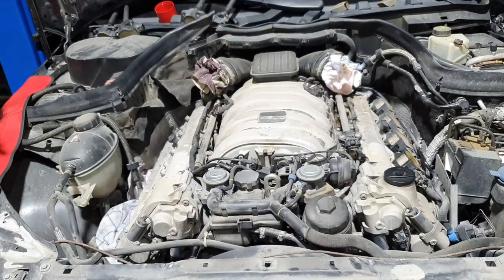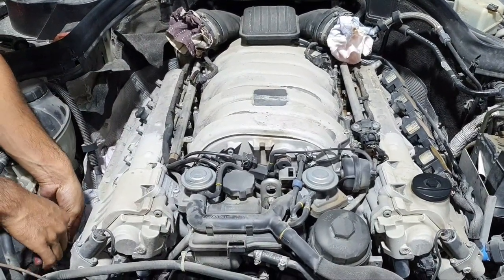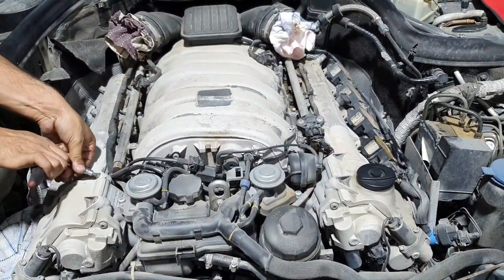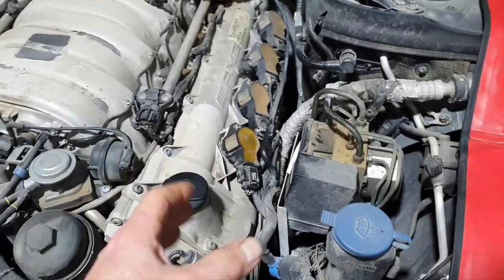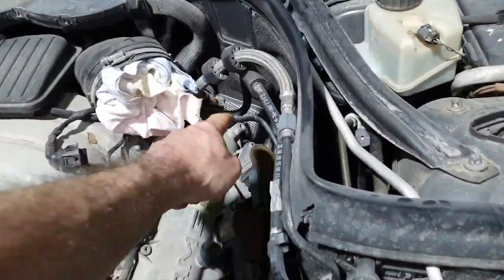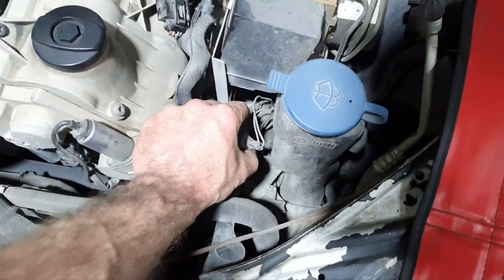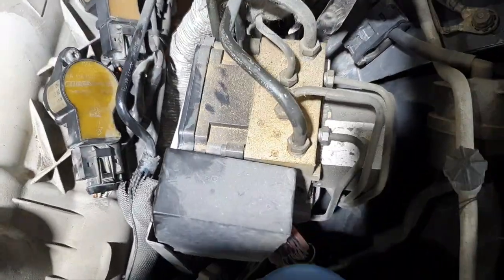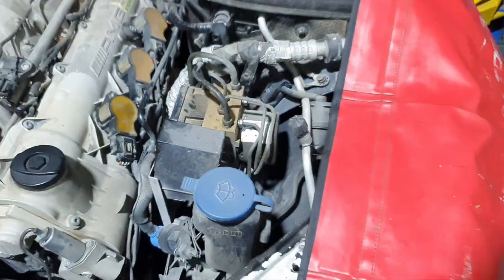All right, stuff like that. Now let's stop the video and put it up again and double check everything, get a crowbar, check the suspension. At least tires and brakes look okay. Seals look like they already changed them. Spark plugs, there is some oil contamination, but if you fix the intake manifold, you're not going to have these kinds of things. The bracket that's missing on this pipe, the other bracket missing on this pipe, the bracket for the charcoal canister solenoid valve, brackets here and there, and I don't know, the ABS unit has a leak or they just replaced it. We're going to see about that.